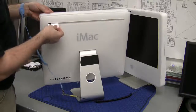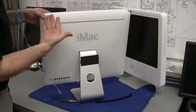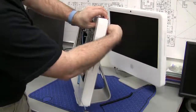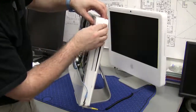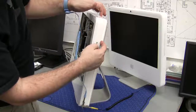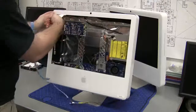You're going to push the card up and you're going to feel a little bit of spring to it, and what's going to happen is it's going to push up against those fingers. When it pushes up, slightly pull on the display panel itself - just very little and as you can see the computer will come out from the back side. So all you need is a little bit of a gap - pull the card out and then work on the other side.